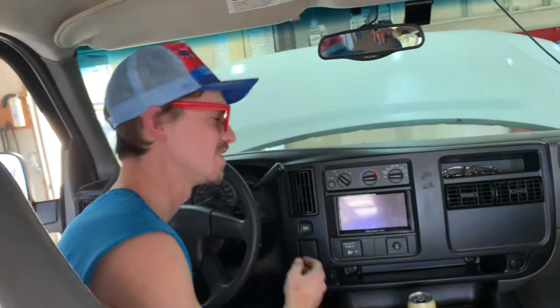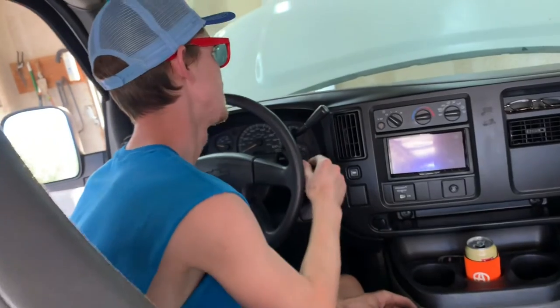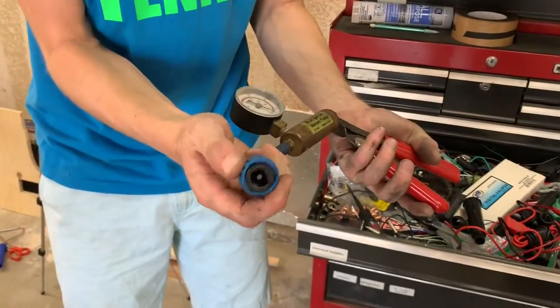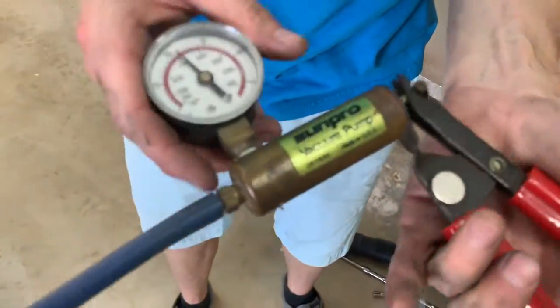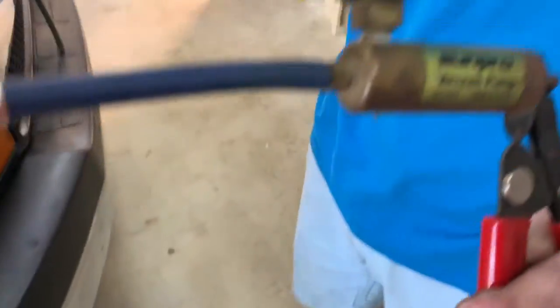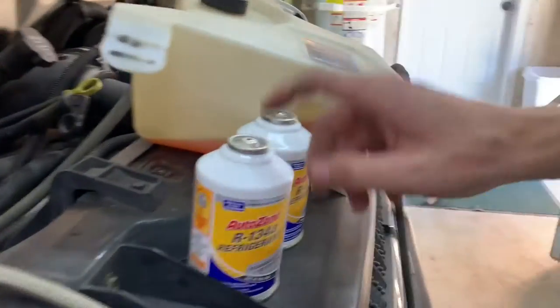Charging the AC now, it's only going to charge the front part and you need much less freon — just a couple cans. We need to vacuum the system first. You can get these manifold gauges on Amazon — I'll drop a link. You're putting it onto a low-side adapter for the R134A. It's not rocket science. Vacuum it out — it makes funny noises, but you don't want any air inside of the system when you recharge it. Air isn't going to compress the same as your 134A freon, it's not going to do the job.